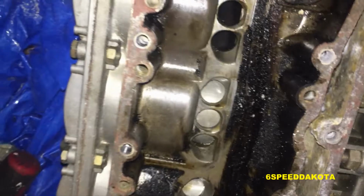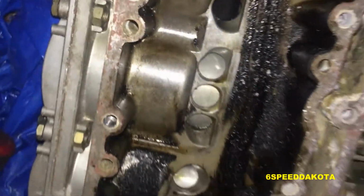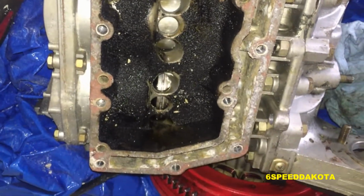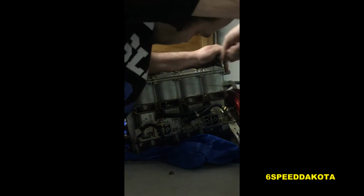The exhaust plate's very badly corroded. We don't have much carbon buildup around 3 and 4, which is a little bit alarming, so maybe we just get some unburned fuel through it. And there we have one very badly damaged piston from the reed valve getting caught in it. Something I discovered a little bit later.